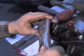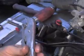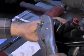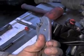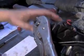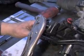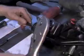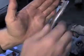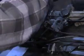Once we get that determined, you remember from our previous reference, we were going to put the vice grips on there at 5 o'clock. So with it buried to the left, our vice grips on it at 5 o'clock, we were turning the half plus the 5 o'clock. So there's the 5 o'clock. We'll start at the half turn. There is 1, 1/2, and we're back to our 12 o'clock. So that way we set up this shaft to this rack as our reference point to start with.